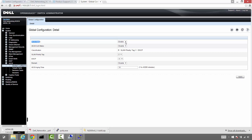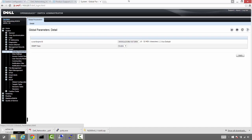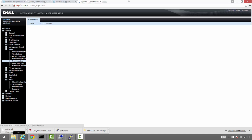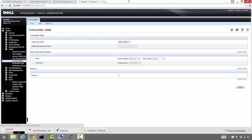Let's do two last things. First, the SNMP configuration — we like to monitor these switches whenever possible. Under SNMP, global parameters, then communities — we'll add a new community string, something relatively generic, and tell it that all management stations can access this switch. Put in a generic community string and hit apply. Go back to the details tab to confirm the setting took effect. Perfect.